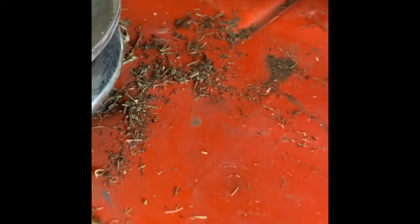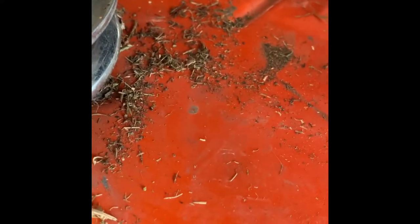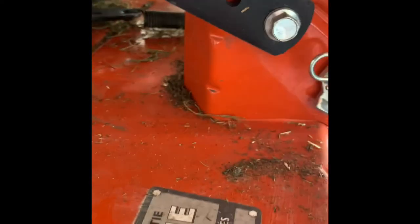When you put your belt on, guide it through the pattern shown on the front of the deck — make sure you follow that pattern. Hook it up to your clutch pulley, which is right there in the middle. The next step is to clean your deck off as best you can — use your hands, then a brush, then canned air — get it as clean as possible.